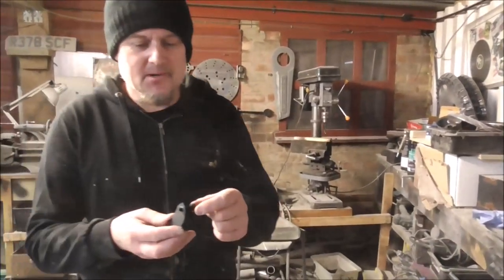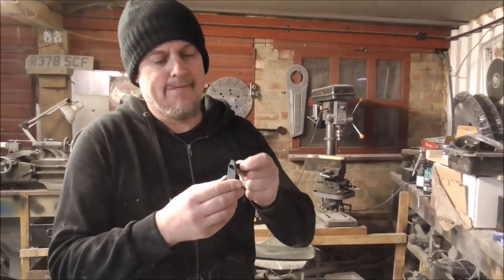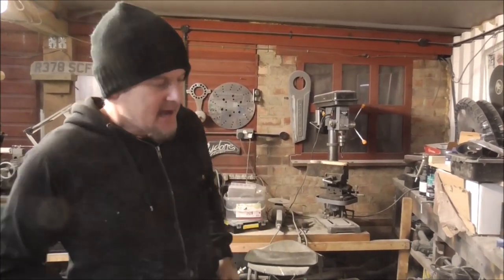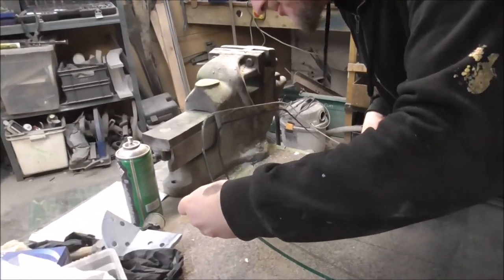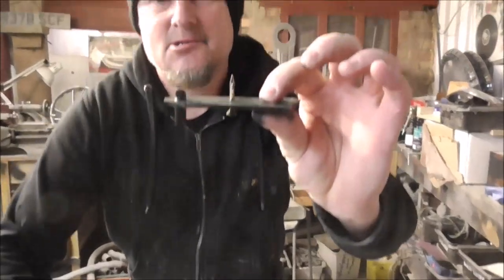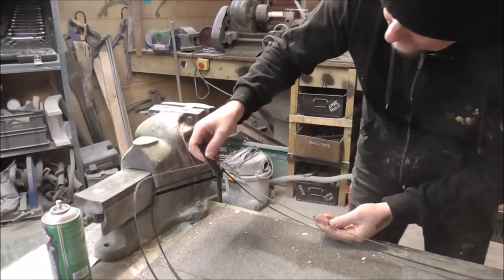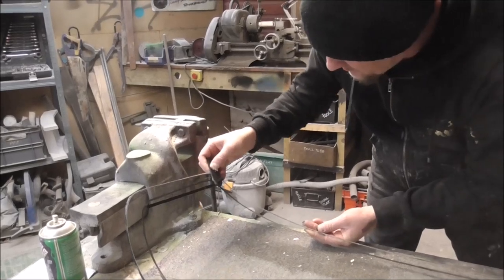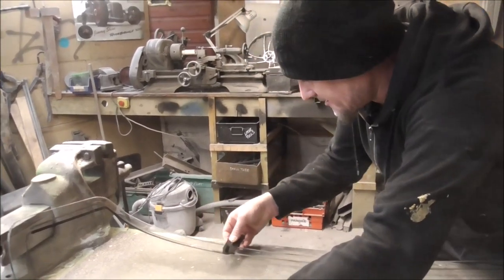To get this perfect border, I've got a piece of foam, drilled a hole in it, got the tip out of a Posca pen and shoved that through there. I'm looking for the widest bit - I think maybe here. I'm going to go a little bit wider than that, put a screw in there, and this will give me my guide. On the corners, always keep it perpendicular - that sounds a bit fancy - always perpendicular to the edge, and run it round.